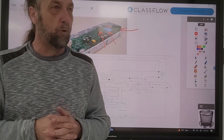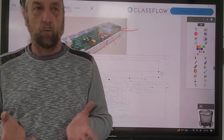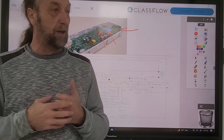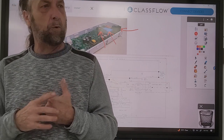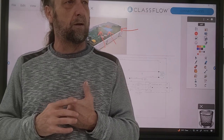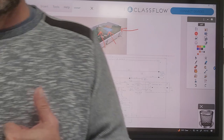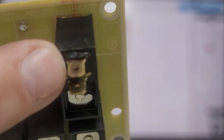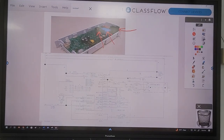Like a microwave door switch - they fail a lot. If you guys can see this relay, look at the plastic there starting to melt around the terminal. Can you see how it's melting around the wire terminal? The others don't have that - see how shiny they are here and how melted that is? This plastic melting here is an indication of electrical amperage being drawn. When you draw electrical current, it creates heat.